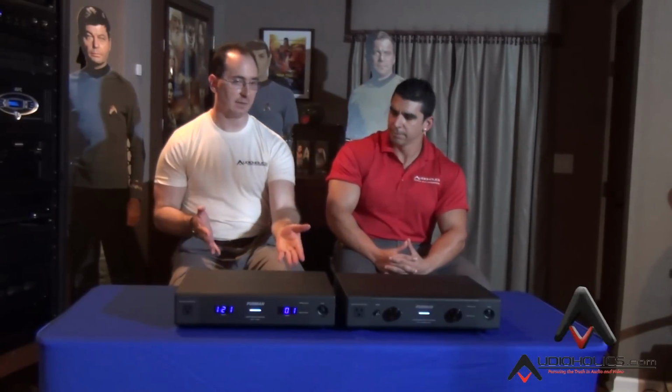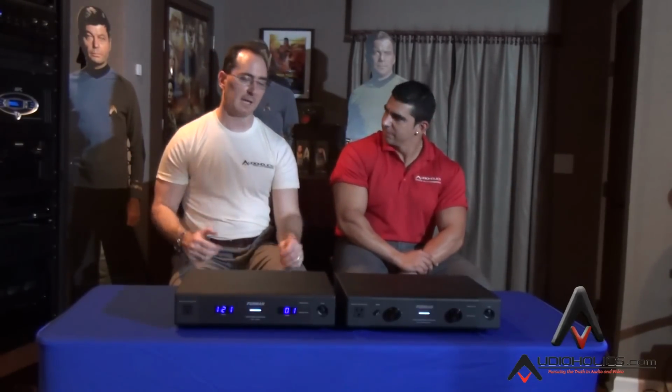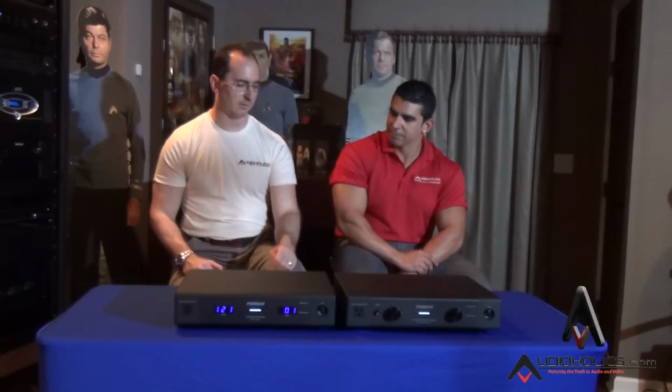And the other thing too, it's not just about the power protection. You've got to plug in your incoming cable or your phone lines. This has all the filter connections for that, because let's say you power protected all your equipment and you plug your cable box not into this, but just into your TV. That creates the path that'll allow the lightning surge to go through. So you've got to really isolate. The other thing is, by plugging everything into one, you're ensuring that your ground is all tied together. There are a lot of benefits to it. In some cases, you could get rid of a ground loop just by using one of these devices.